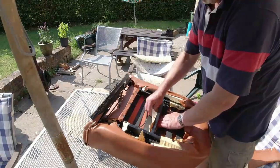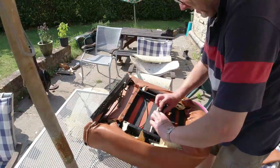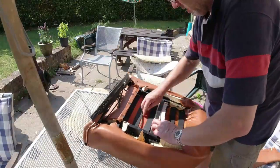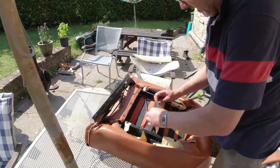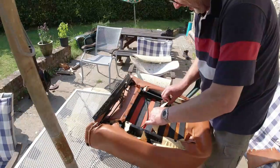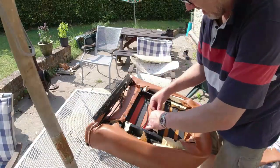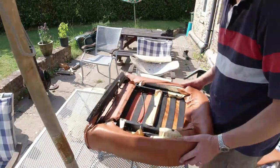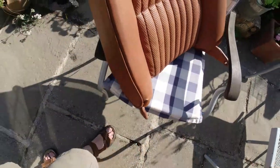This piece of webbing I'm tugging on now is the bit that goes across the line in the middle of the basket weave — this is the one that's probably the most important to get in the right shape. You want to avoid unsightly creases up the bolsters. You want to avoid the seat being as baggy as possible. This is the one you really need to pay attention to. And then once it's all done — I still need to punch the foams a little bit — it looks like that.